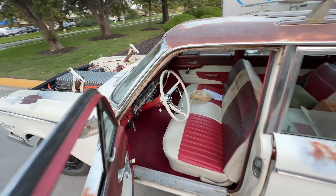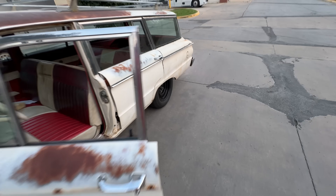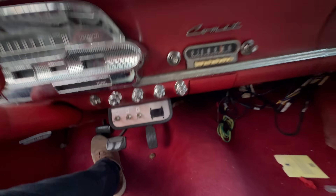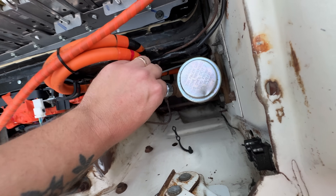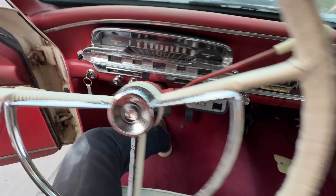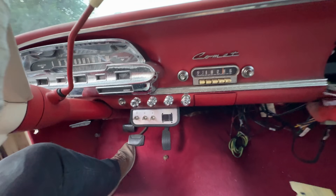Well, it's broken. It's like the Resolve doesn't have any power. It's like the VCU turned off and it won't turn back on. Got nothing here. The brake lights are on, so the brakes are locked up — it felt like that while driving. I'm going to pull this here, because it's a pressure-activated switch, not a foot switch on the pedal. And nothing. Okay, so I have multiple problems.